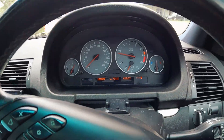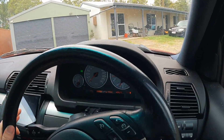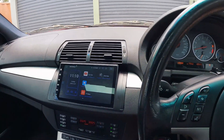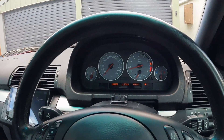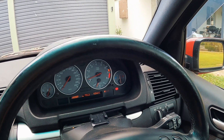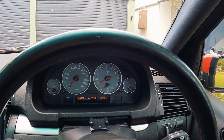Just getting back from the drive and yeah, no errors. Indicators are all working. I did a quick light check while I was out there — the lights are on, radio dims — it seems to be fixed. I'll do another restart because we've still got different mileage between the EWS and the IKE. We'll just scan that again and see if it's updated now that we've done a few Ks.